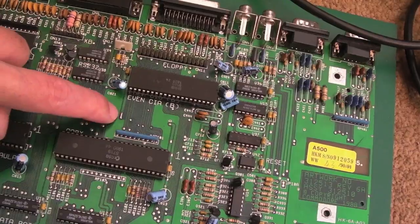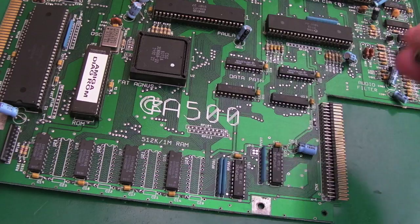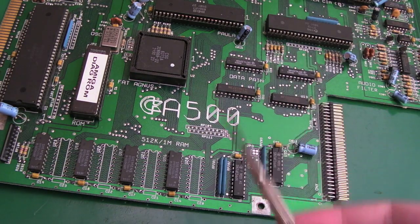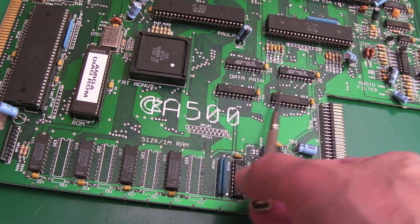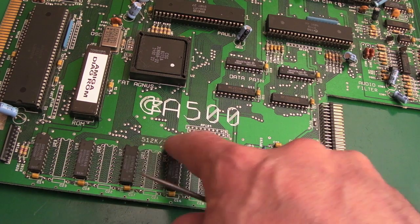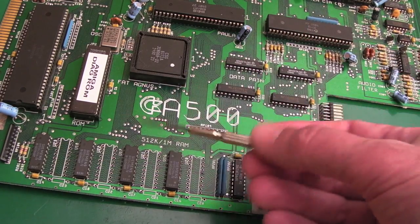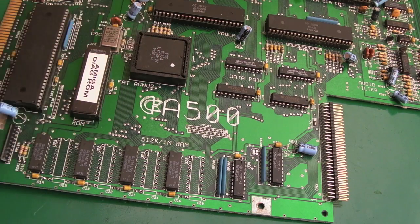I'm not sure what was actually causing the initial faults with this. As you'll see in a future video, I need to do more testing - connect keyboard and floppy drive, boot some games, and work out why I'm getting that address failure when using DiAGROM. I suspect it's going to be something to do with the data path. This board is a rev 6A - it's got the extra spaces for another 512K, so it says there 512K to 1 meg. The 8372A is the one that allows up to one meg of chip RAM.